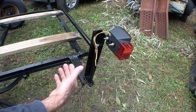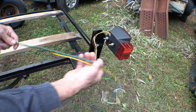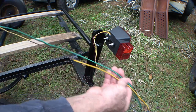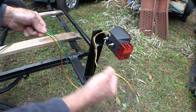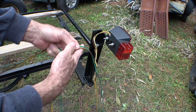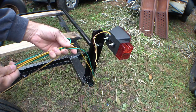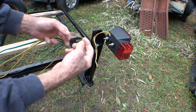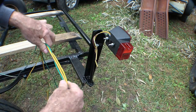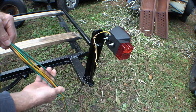To make roadside repairs easier in the future, I'm going to steal some wire off the old wiring harness and put about two feet in there, then stash it underneath the trailer. If a wire ever gets broken off, you just cut the tie wraps, pull the extra wire out, and you've got something to work with instead of everything being super tight.